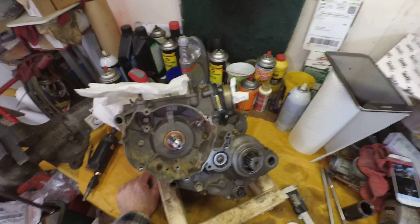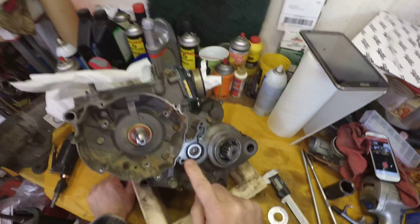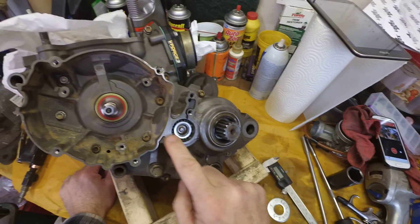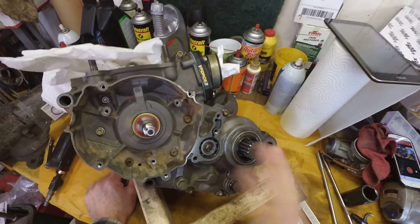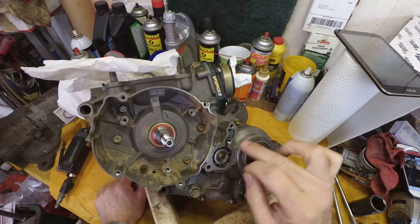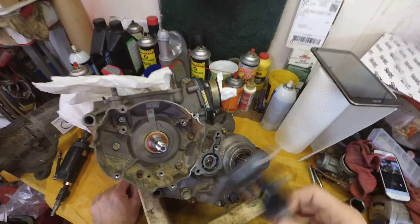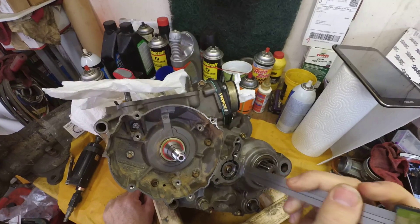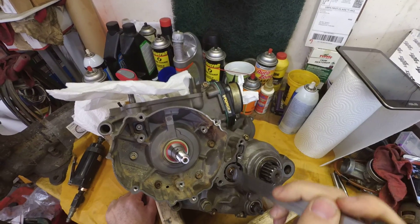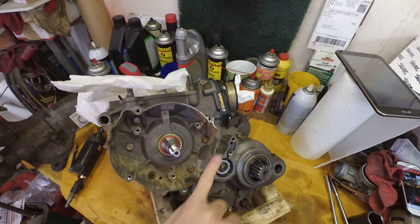It is easy to set it up properly, so let me show you. Basically what you have to do is measure the distance between this flat surface right here and the center push rod. There is a special tool you can use — it has a flat surface that you put across here and then slide it down. But if you are like me and have regular calipers, you really can't do that because when you set it up on the side you are not able to get down to the middle. So what you want to use is just some type of washer that you can put flat on the surface.